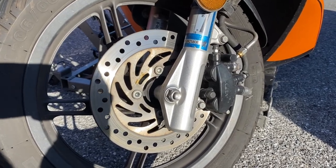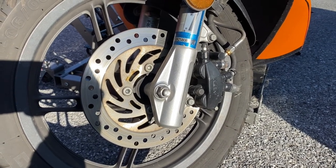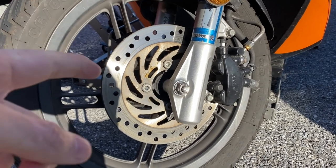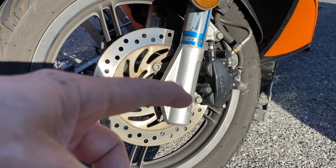it's time to replace my front brake rotors. I'm getting a lot of brake fade and the pads are getting a little thin. So I'm going to take off the rotors, remove the caliper, give it a quick once over with brake clean.